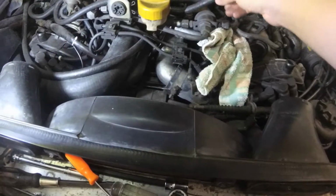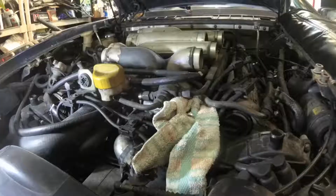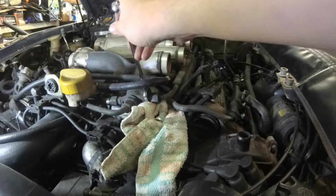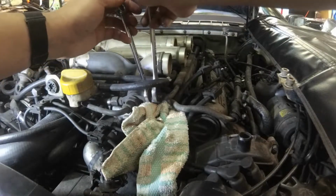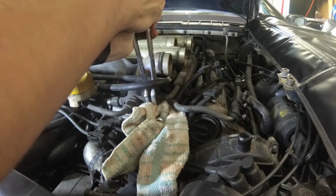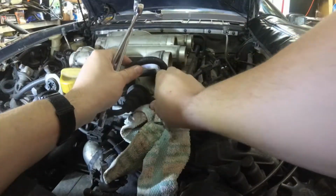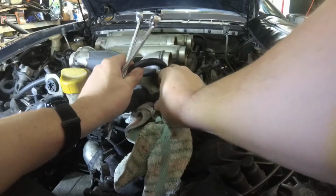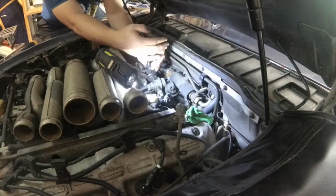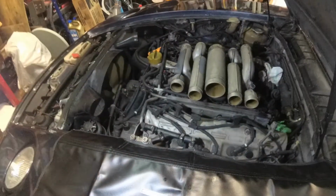Yeah. Alright, so now we're pretty much at the time where things can start getting messy. So we're going to have to get the fuel rails off, so I've got to get them disconnected from the damper. I don't think I've cracked these loose before, so I'm hoping it'll come loose, and it did. It's a little wet already. I sprayed some Kroil on the threads to start. Alright, so took out the two bolts there and there that hold the fuel rail in.